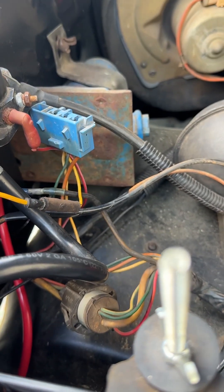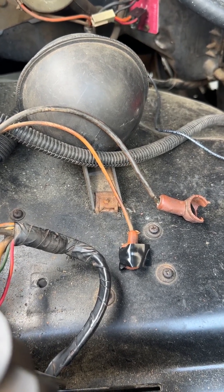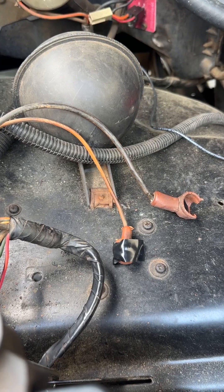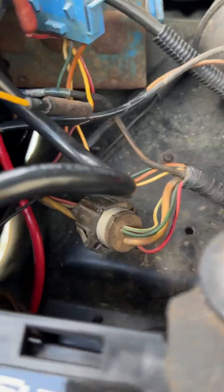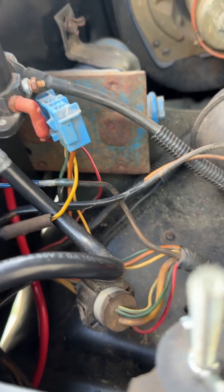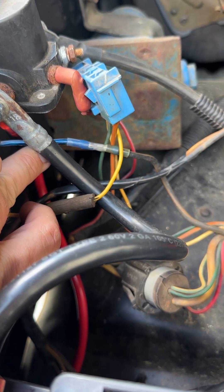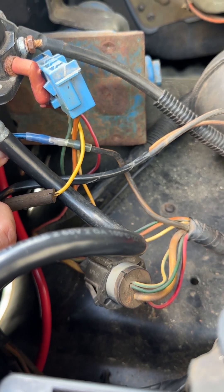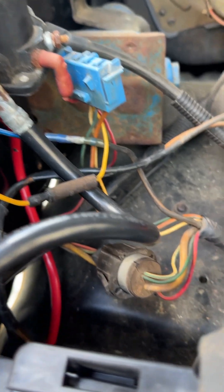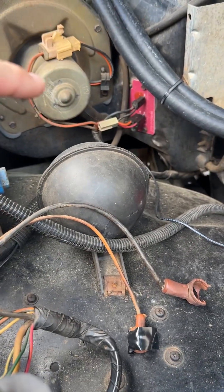So you disconnect your voltage regulator. You disconnect those two wires from the old alternator. I temporarily put some electrical tape over them just so they don't accidentally touch anything else. And you leave that blue wire plugged in — that goes into the old wiring harness. I had burned up a fuse link at one point prior to this. Anyway, through this terminal is how the power is being fed through this harness into those wires and into your dash.